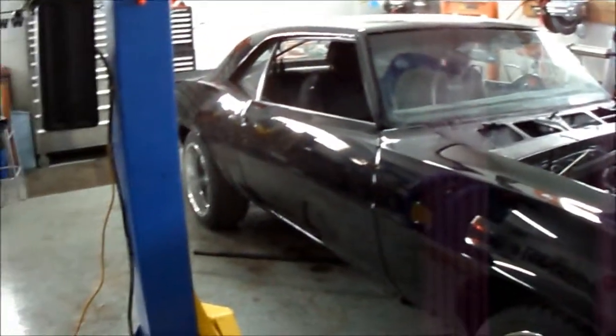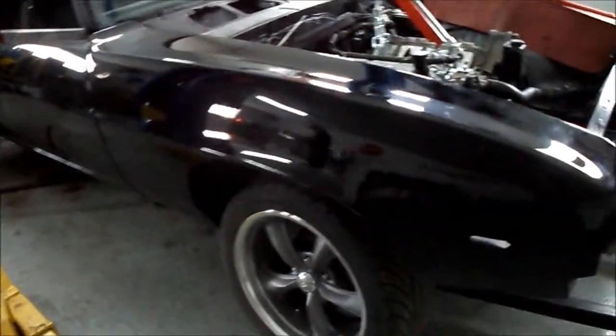The issue, I guess what comes into play is the oil pan is a muscle car oil pan, and if we don't lift the motor up anymore, it kind of barely just touches the frame down there. And I guess guys are having the same issue with the Holley oil pan, which to my understanding is the same pan as the GM muscle car oil pan, just with a Holley stamp on it. A little bit different, but pretty much essentially the same pan.